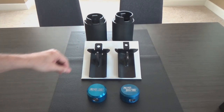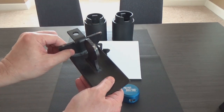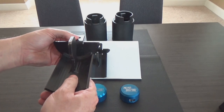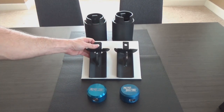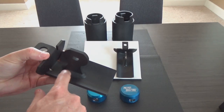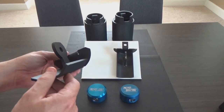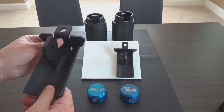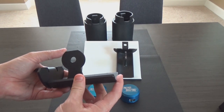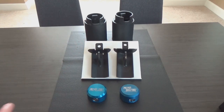There are some subtle changes to the inner slide. The old inner slide was a three-piece design — you had the ball, the bottom part of the sleeve, and the part that holds the tongue, all welded together with their precision welder. With the new one, they moved to a two-piece design. They've put folds in the sheet instead of a smooth radius. The ball is welded on in the center, then it's cut and folded to form the shape of the inner slide. Structurally, I don't think that's going to make any difference — it's going to be crazy strong anyway. You'll also notice it has a hole in it, but that doesn't serve any functional purpose; that was just to help them get it out of the sheet after cutting it with the laser cutter.